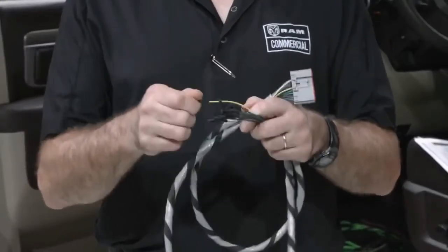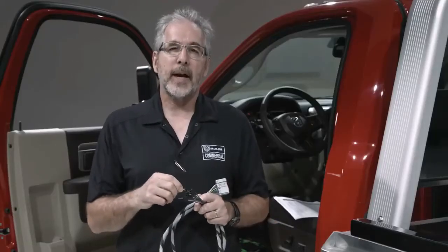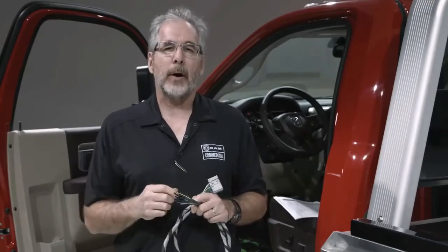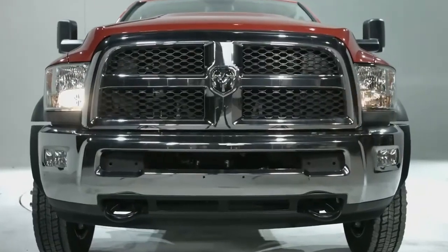Here's a solution. On the gray VSIM wire connector, which connects to a small connector just next to the VSIM module, is this wire — a yellow wire with a blue tracer. This wire only becomes ground, or stays ground, when the vehicle is in park. So if you use this wire to connect to your wigwag lights and inadvertently leave them on, as soon as the vehicle comes out of park, the wigwag lights will turn off. That covers activating your wigwag lights.